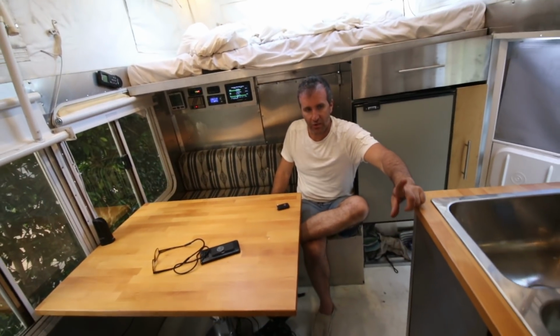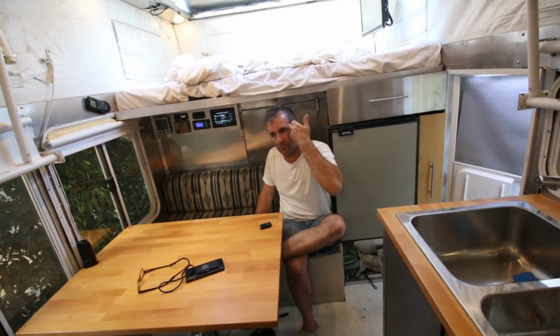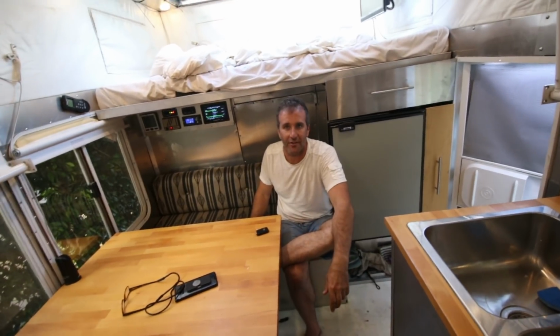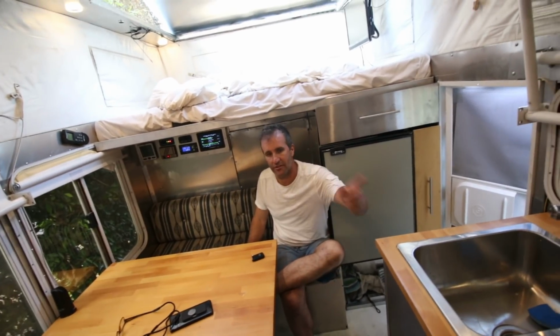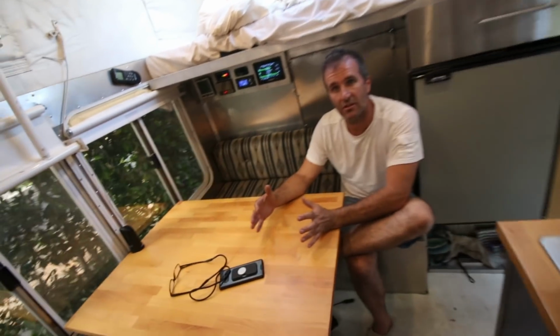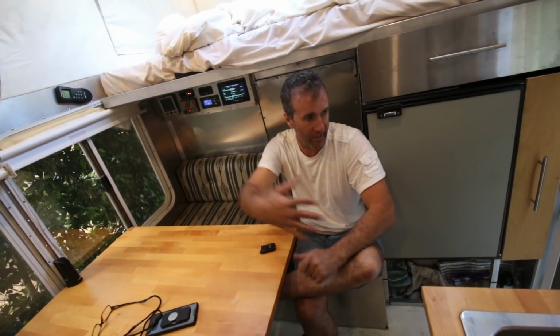And it also has a diesel water heater that they use pretty much in Europe. I had to order it from there, because they couldn't find a distributor here. What it does is heat a 5 gallon water tank, which goes to a radiator, and then a fan heats the truck.